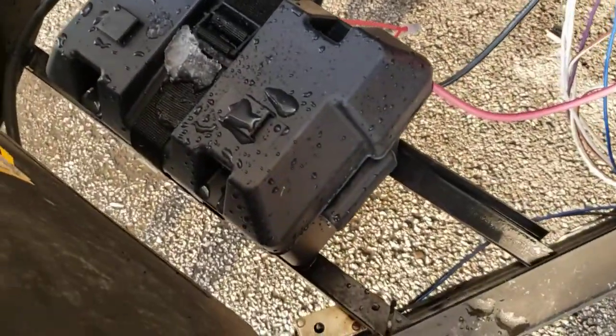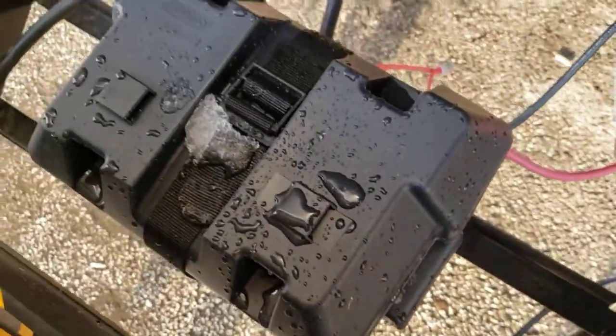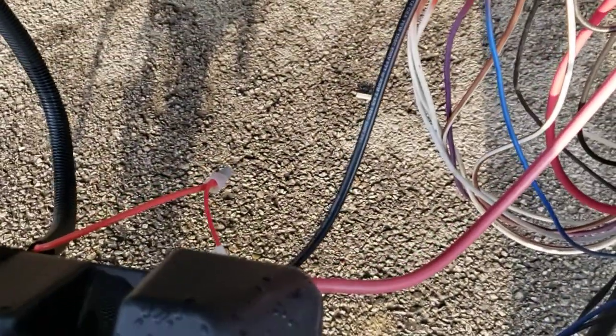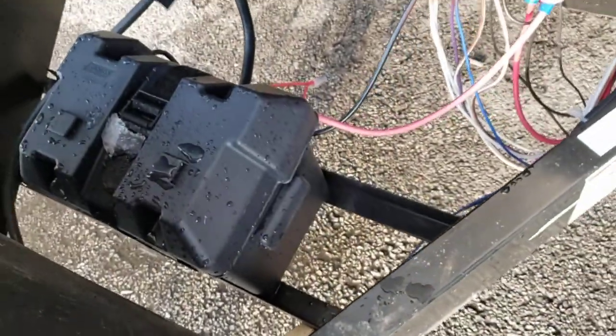Group 24 RV marine grade battery. In the winter I definitely recommend taking it out and keeping it somewhere warm. If it's going to be a long time between trips — a couple of weeks — I recommend disconnecting your negative lead, the black one. That's going to keep anything from using the voltage on your battery.